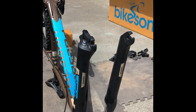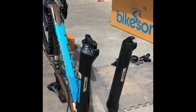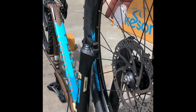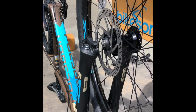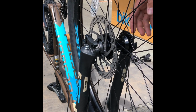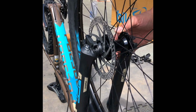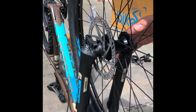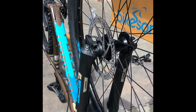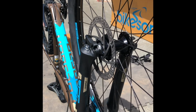Let's see if we can get to where we can set the front wheel in there. So here we go. So the front wheel is going to go in. Be very careful with it. Be sure. So this is where it sets through in there. Sometimes you gotta. This one slides in really easy. Be sure those pads don't slip through, and you set the disc or the rotor behind one of those pads. That's not good. So anyway, we got that set in there. And as you can see, that's how it sits, that's how it goes.